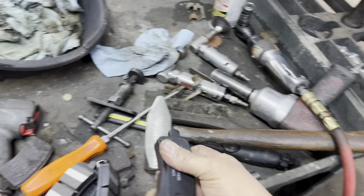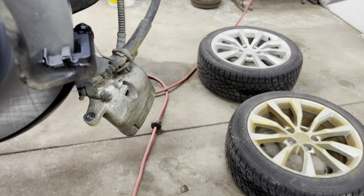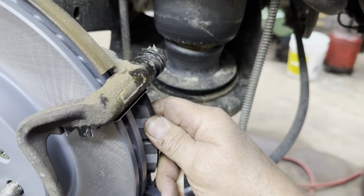Get your brake pads — if one has squeak indicators on it, put that one on the inside. For the outside pad first: take the pad, make sure the outside face is away from the rotor, put it in there, push it up against the hardware and push it in. The hardware clips act like little springs — angle it a little bit and push it in. Then put your caliper in, making sure to push the pins in so they don't get stuck.